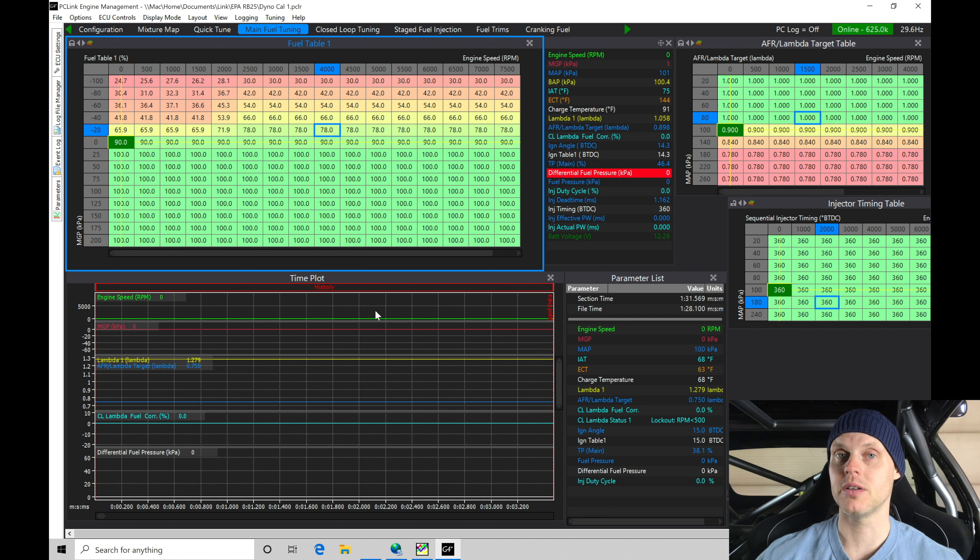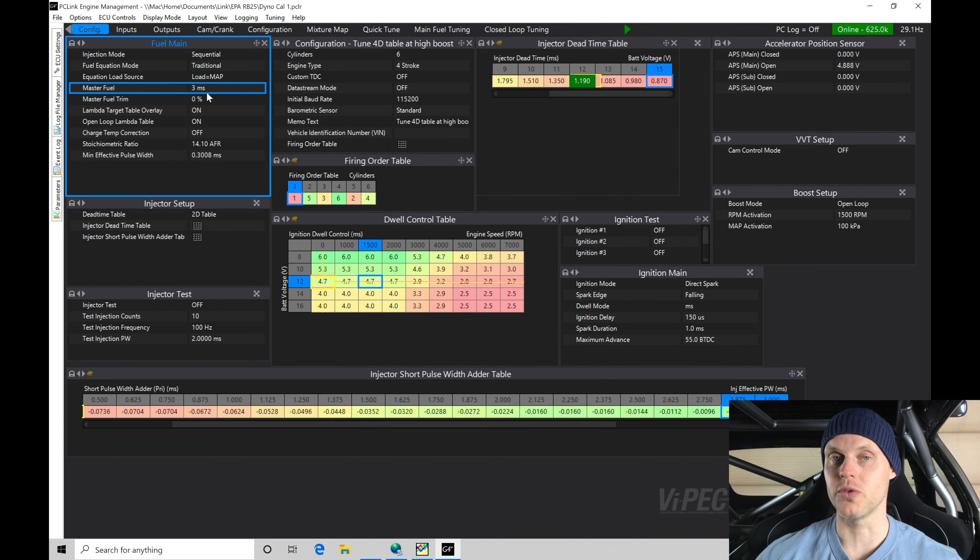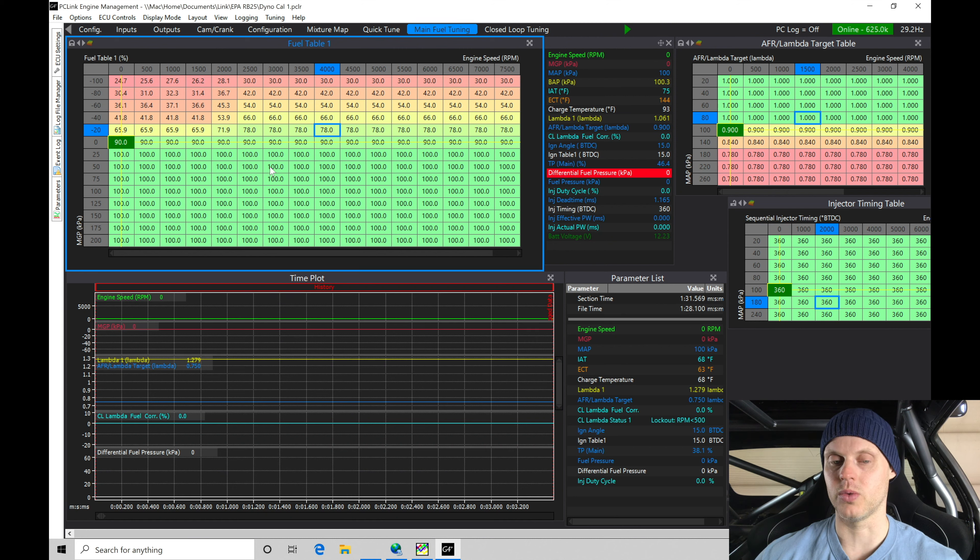At the beginning of the second video, we got the engine fired up and running, and I started to manipulate — jumping back into our configuration — I started to move my master fuel value down to take away fuel that was running extremely rich with this particular setup. Reducing that master fuel value will make the values higher and bigger in my table. What we want is that when we're roughly at zero psi, we want to see about 80 to 100 raw value in the table, and at part throttle midway — around negative 60 MGP — we want to be around 50. That gives us ballpark values to get started with and to fine-tune the injector pulse width delivered.